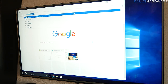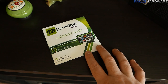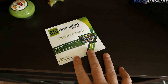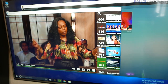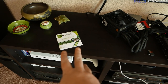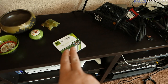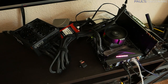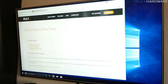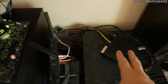For HD Home Run Prime setup, you just go to a URL they indicate in the Quick Start Guide, and from that URL you can see the HD Home Run Prime is connected with some additional functions. Silicon Dust actually provides their own software for the HD Home Run Prime which allows you to do basic TV tuning and live TV. By default out of the box you can do up to one day of programming guides and watch live TV. You can pay Silicon Dust an extra amount per month to include DVR functionality and two weeks of electronic programming guide. However, since I already knew I was going to use Plex, I really just verified the device was working and went directly over to the Plex software.